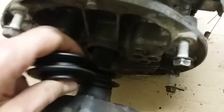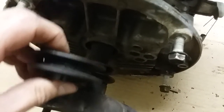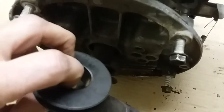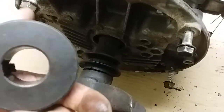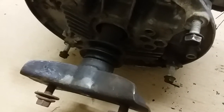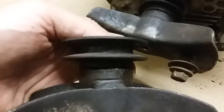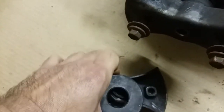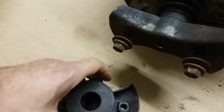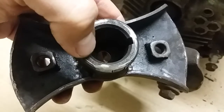This one here was frozen on bad too. Even once I got the outer part off, I had to get the puller and put it on the top of the pulley, tighten it down as tight as I could, hit it with heat, and it would pop a little bit. I'd have to tighten it again and heat it, and keep doing that for a while. The keyway is cut completely through the shaft going up, but on the other part there's a separate keyway on the opposite side.